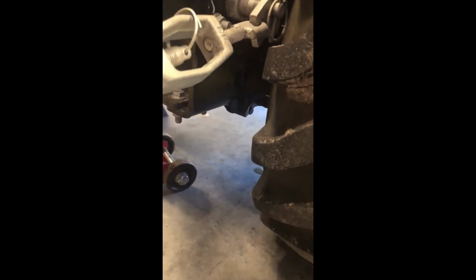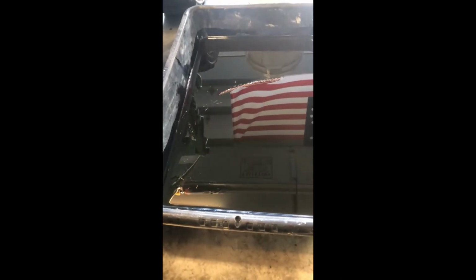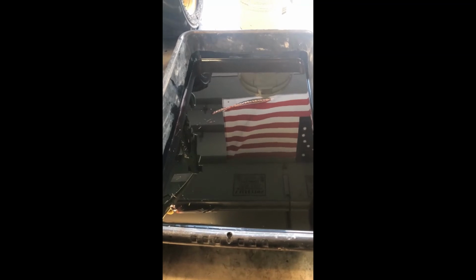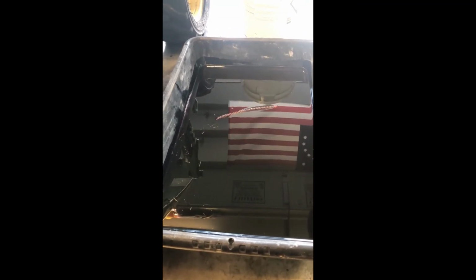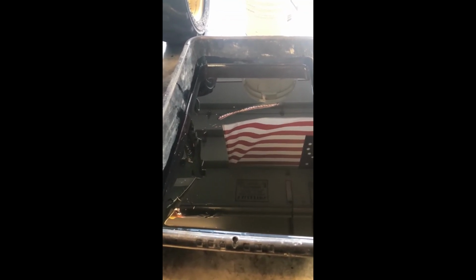All right, so drain plug back in underneath. That's where we're gonna fill it. We haven't done that yet, but that's our last step, is to put our fluids back in. It's gonna be about 3.5 gallons of fluid. And that's why, again, I had said, make sure you have a big enough pan. I got a very large pan, but that's about 4 gallons of fluid that came out of the machine. So if you don't have a big enough pan, it's going to be a bugger, but you could do it, stopping and going with it. But make sure you realize there is 4 gallons roughly.